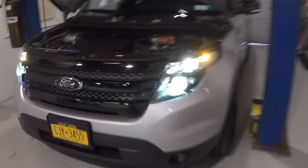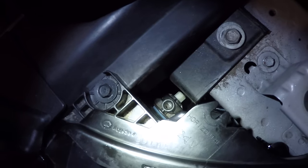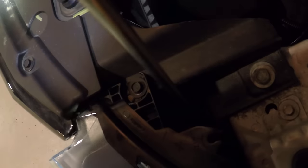I'm going to shine a flashlight over in the engine bay. All headlights are adjustable from the engine bay. You can see that gear right there — the Phillips head screwdriver is going to float right into there. It's a little hard to see because I'm doing this by myself, but essentially it's going to go in like that and you're going to be able to spin it.